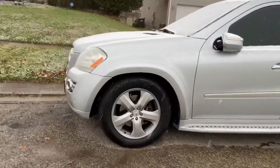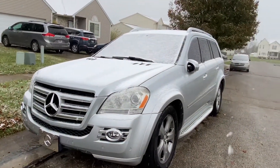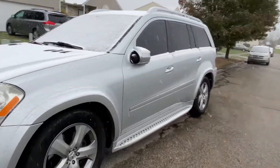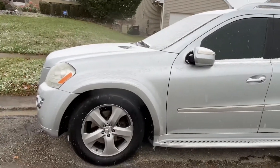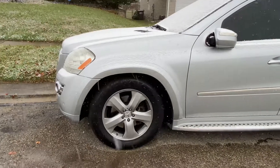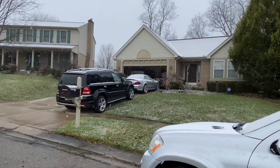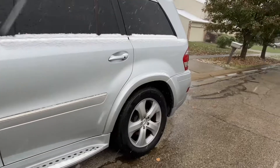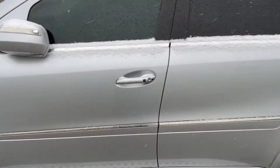If I start this car up it'll raise back up. In this case — my wife's GLE 550 — it takes sometimes a week to drop down, sometimes a few days. The longer I let it go, the shorter those intervals will become. It will drop faster and faster. Before long it might not raise back up, might drop down in a day. That means it can no longer hold pressure and the strut likely needs to be replaced. In this case it's not making any noise — it holds pressure when inflated — but when it's parked and the vehicle is off, it drops down. That is an issue I need to resolve.